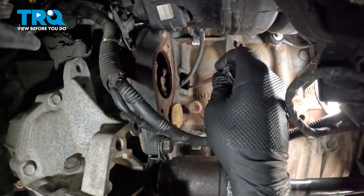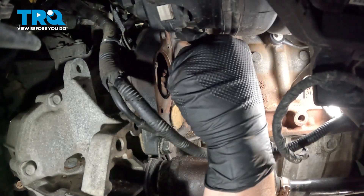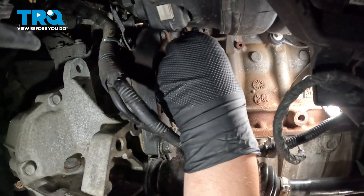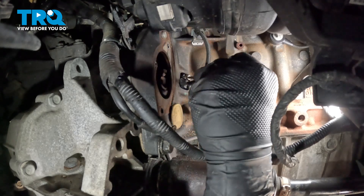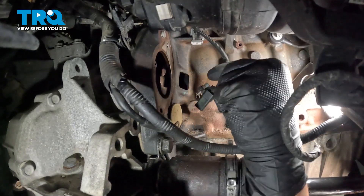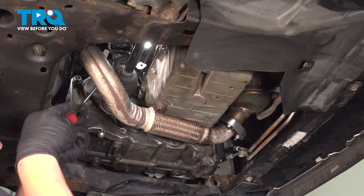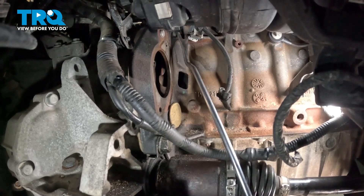Using a 4 millimeter Allen head, we're going to get on the bolt on the backside of the wire. You can't see anything, so you have to just feel around. Remove the sensor. The sensor gets held inside of this insert and it's threaded into the insert. What we don't want to do is keep unscrewing it out of the insert, because then it can fall into the motor — and that's what we're trying to avoid. Remove the plastic connector off of the metal tab, or remove the metal tab, and then we can replace it.